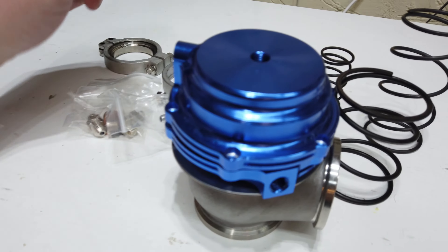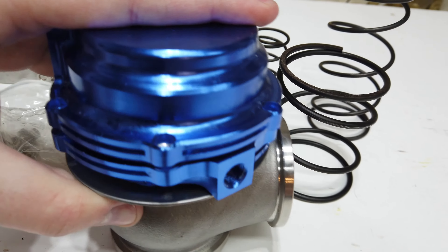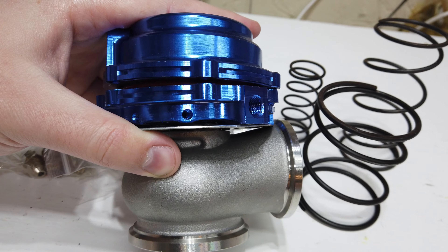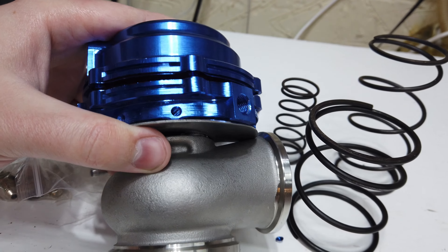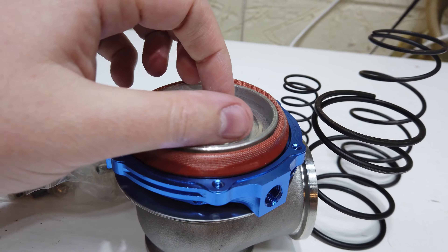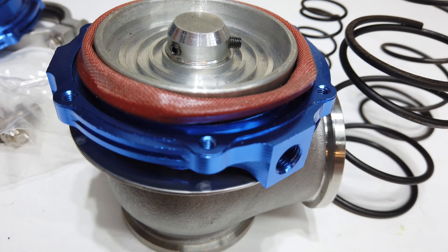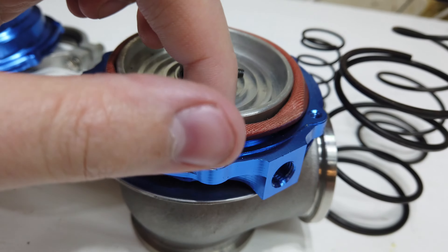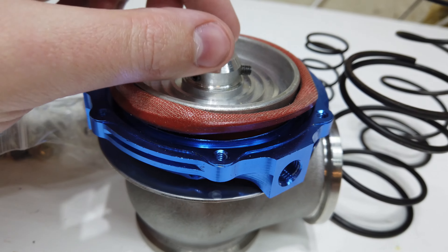The reason I don't think this is particularly good: firstly, when I got it and dismantled it, it wasn't square on the housing. The valve was seized - I couldn't actually push it in. With the top removed you can also see that part of the valve was damaged - it had been pinched, which obviously means it's not particularly great to start with.